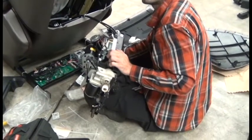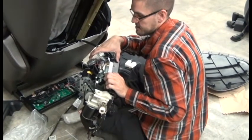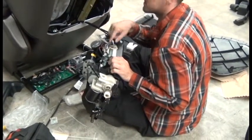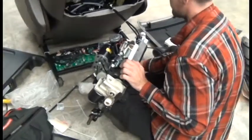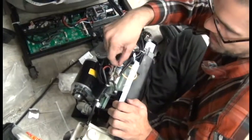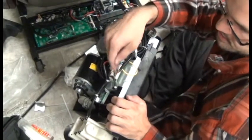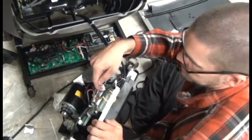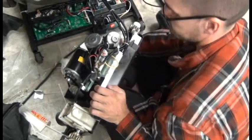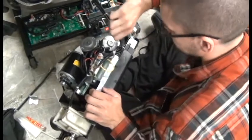At this point we can power off and unplug the chair. I would recommend powering off and unplugging for safety purposes since one of these is a hot power wire. The ground is right here; all four of these screws are acceptable grounding locations. Communication cables are right here — unplug this cable, undo this screw, and cut these zip ties; that will free the mechanism.